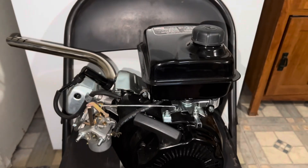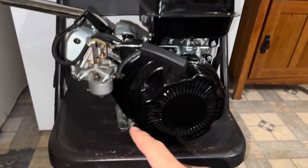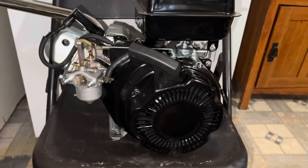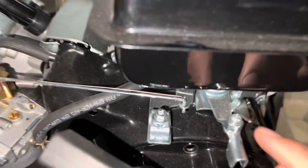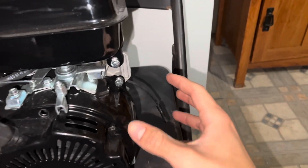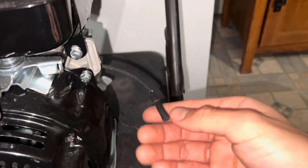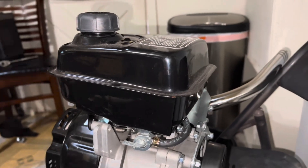If your engine's on a minibike, the low bolts for the engine plate are usually 10 millimeters. If your throttle linkage is connected, just use a screwdriver, unscrew them and take it out. If you have a kill switch, your ground is usually gonna be connected to one of these bolts, and your power you just pull and disconnect.